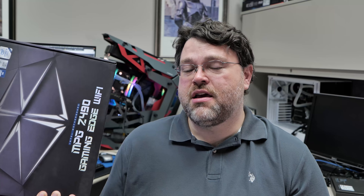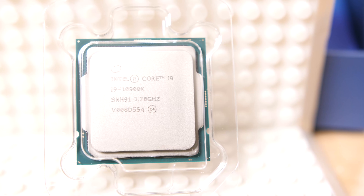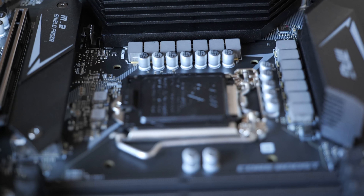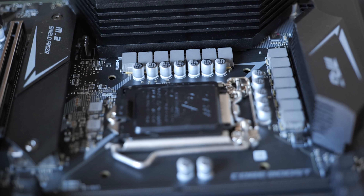I'm going to take a look at it specifically with the 10600K, although even if you are running the i9 10900K or the i7, this would be a perfectly suitable motherboard. Really, the thing with the 10th gen CPUs is they drink the power. The power delivery system on this motherboard is 12 60-amp phases, which is adequate unless you're going to spend more on your cooling setup than you did on your entire rest of your machine.